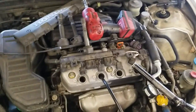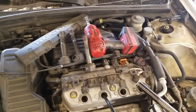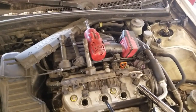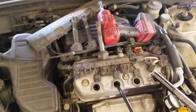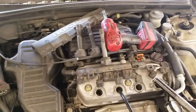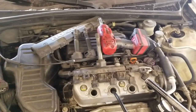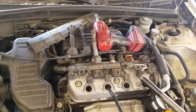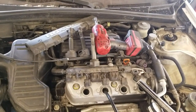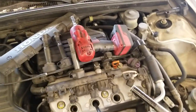Here's one way to check if you have a blown head gasket. This customer came in with low coolant and the temperature gauge shooting up. I added coolant, ran the motor, and didn't see anything unusual — nothing out the tailpipe. The fans were turning on and off, the heater core was working, but the heat from the heater core was a little on the high side temperature-wise.